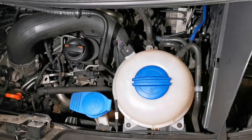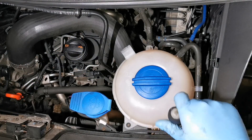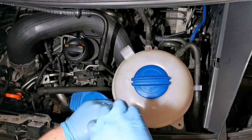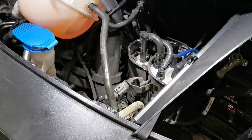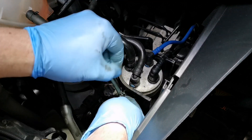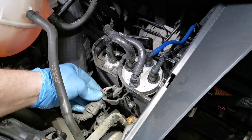And now onto the diesel fuel filter. First, for ease of access, we need to move out the coolant reservoir — take off the multi-plug and remove the two Torx 25 screws fitting it to the bracket. Gently moving it out of the way reveals the fuel filter. There's one 10mm bolt that acts as a clamp and holds the fuel filter in place, so by loosening this off you can provide some slack and remove the filter.